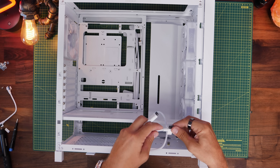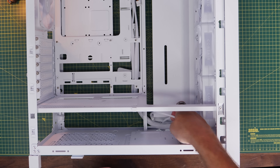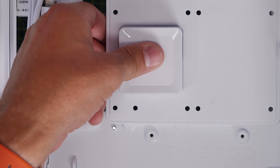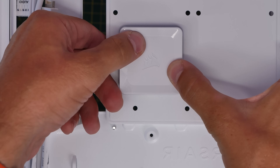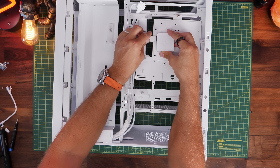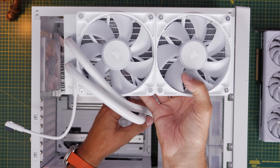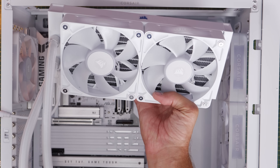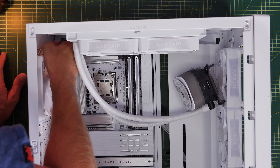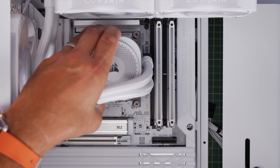When installing your fans, make sure you've got the cables connected first. I'd recommend plugging the cables into the fans before installing them into the case, as it can be fiddly to reach in afterwards. The controller comes with sticky tape so you can mount it - on Corsair cases there's a nice spot, but it should be easy to find a position in most cases. Pre-attach the small fan cable to the radiator fan end before mounting the cooler, as the gap in the top left corner will make this very fiddly otherwise.